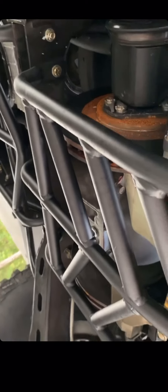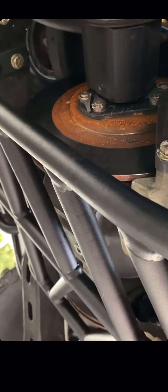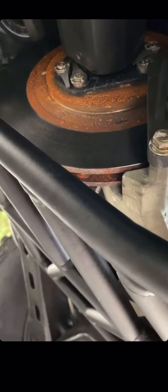We have our diff and Blue Hummer locking half shaft bolts. We also have the locking diff hardware on here and all the well-known locking spindle nuts. We Cerakoted the calipers because we got tired of them rusting and looking like crap — that's a 10 inch rotor, so we get a lot of extra braking power. We mounted them alpha style, which gave us clearance for the coolant pipe, which was welded in-house to go up and over the diff.